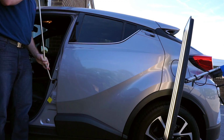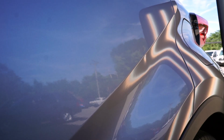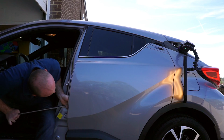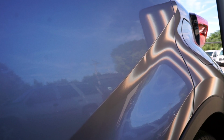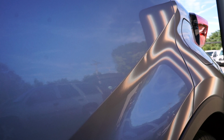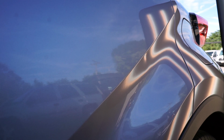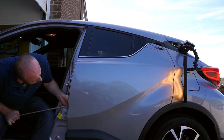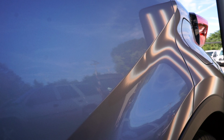That's it. What makes this repair challenging is that this dent is on the body line and also on that curved area. It's very difficult to do some cross-checking, and it gave me a little bit of a hard time, as you kind of expect. I'm not exactly sure if it's regular mild steel or high strength steel, but it was a bit hard to push, so I'm assuming it's high strength steel.